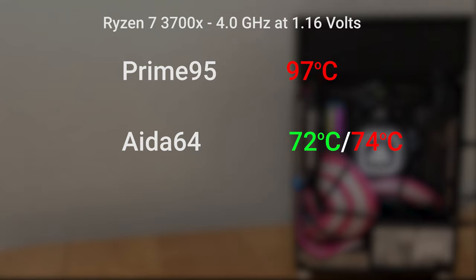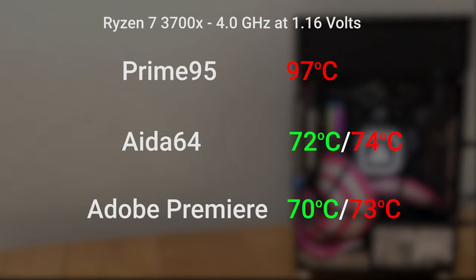I also tried rendering the first 6 minutes of this video with Adobe Premiere, 4K 60fps high bitrate software encoder. Temperature averaged around 70 and maxed at 73. The task completed in 15 minutes and the editing process felt just as good as my 9900K system.